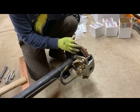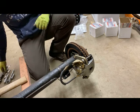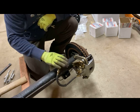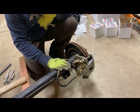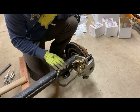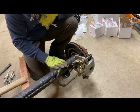Since I want to save everything and put it all back on the car, I'm going to try to keep everything in order as close as I can as I take it apart, and lay everything out so I can put the pieces back together when we're all said and done. One thing you want to watch out for as you're taking apart anything that involves a brake line — first and foremost, if you touch brakes at all, make sure you know what you're doing. You're talking about the safety and your ability to stop your vehicle, so make sure you understand what you're doing or have a professional double check your work. Also, the brake fluid that'll come out of these lines is corrosive to most paint and most plastics. If you're doing this on your car and have a finish you care about, be careful of what this drips on. Make sure you douse that in water and get it cleaned up as fast as you can.